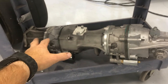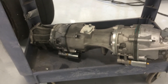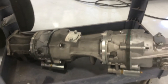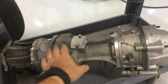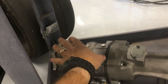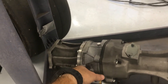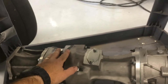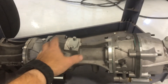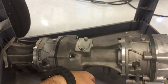This is the pair of Gear Vendor overdrives that I just dropped out. These were used when we broke our best quarter mile time and ran in the nines — 9.89 at 140.2 miles an hour. These are from Gear Vendors: this is two overdrives. The first overdrive has an adapter plate that allows it to slide up on the spline — the Turbo 400 spline — and bolt up just like it would if this were a transmission. So this is one overdrive and then a second overdrive with the tail end on it that goes back to the rear end. The beautiful thing about these Gear Vendors is they're designed to be bolted into series if you want to continue to add more overdrives.